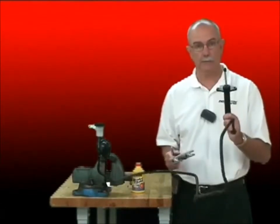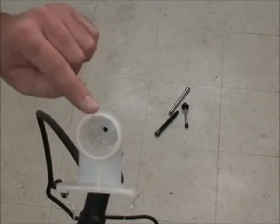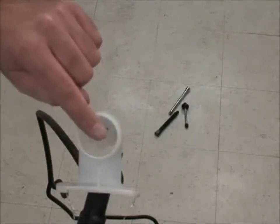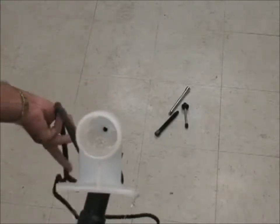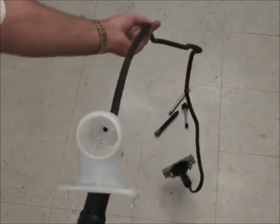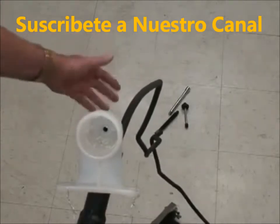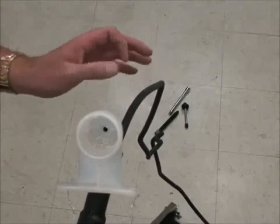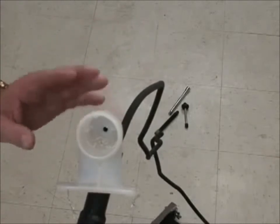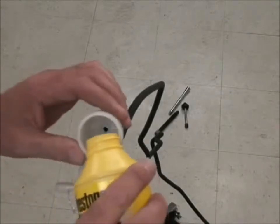Bench bleeding this external slave cylinder system. I've got the camera set up on the bench above the master cylinder so you can see the fluid and the bubbles that are going to occur. I'm going to start filling this up with DOT3, but where I'm going to be working is down on the floor with the slave cylinder, my 3/8ths extension as a pushrod, and using the steering gear puller as a means to block the slave cylinder so we'll be able to test our work.